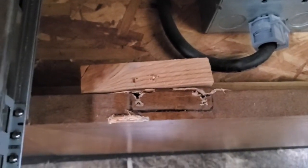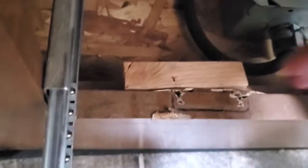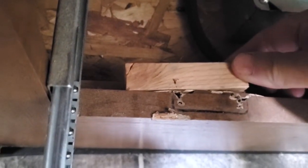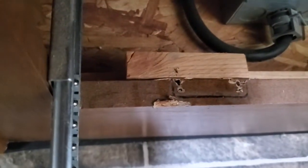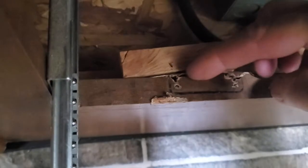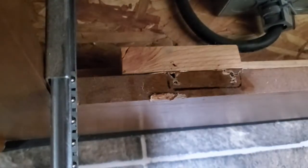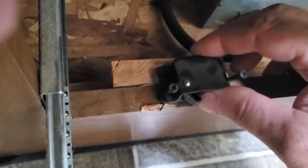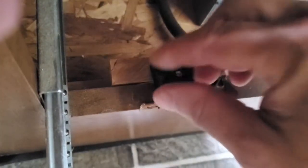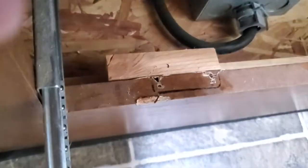I took that closing mechanism off. As you can tell, this block of wood is thoroughly broken out and loose — just in sad shape. I'm going to pull it out, put some glue down in this crack here and also across here, put a clamp on it to hold it shut. Then I'm going to reinstall this door closer, but I'll move the screw itself to the back and screw it down into that block of wood.